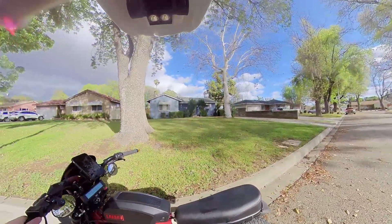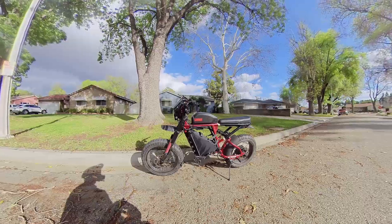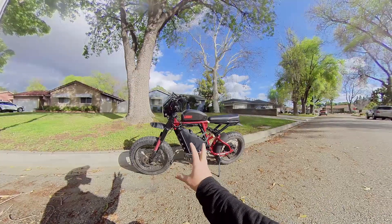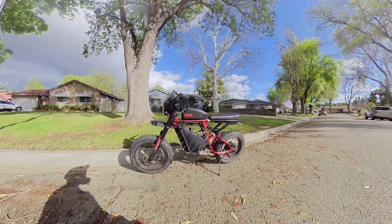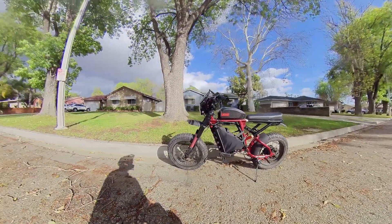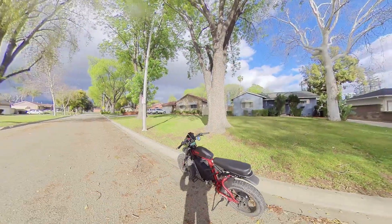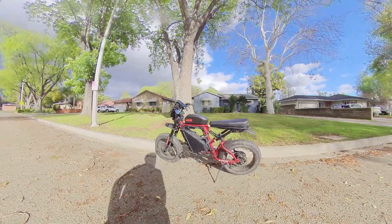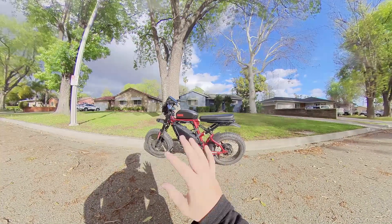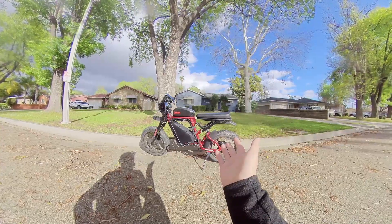Just a quick look — I didn't spend a lot on this kit. I got things separately: the phase runner separately, the cycle analyst separately, and I bought a 72-volt battery. It's only about 20 amp-hour capacity and only goes about 60 to 70 peak amps on the discharge. I'm not fully upgrading it to go over 50 miles per hour — I was really only hoping to get maybe 40. Earlier my map said 37 miles per hour, but then I did some fine tuning and lowered some settings, and now I'm only getting 33.